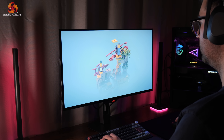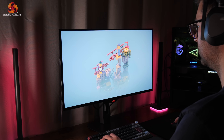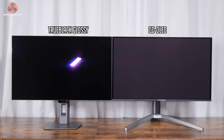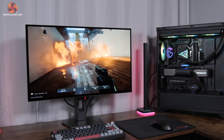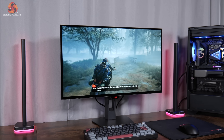Bringing us to the end of the video — given this is the first monitor we've seen utilising LG's brand new 4th generation Tandem OLED panel, it's hard to be anything other than supremely impressed with the ASUS ROG Strix XG27AQWMG. This panel offers a huge range of improvements that really elevate it above the competition. Brightness hits almost 325 nits for a full-screen white while in HDR we saw highlights of almost 1600 nits. The gamut offers much higher coverage than previous W-OLED panels, and lifespan is claimed to be significantly enhanced thanks to the extra layer. The True Black glossy coating adds another dimension, factory calibration is stellar, and the built-in sRGB Cal mode is one of the best sRGB modes I have ever tested.